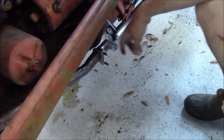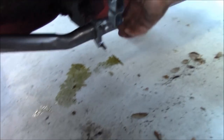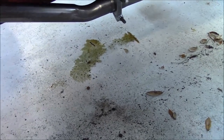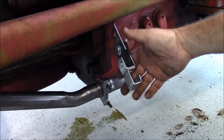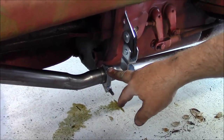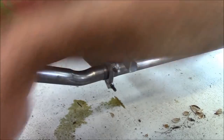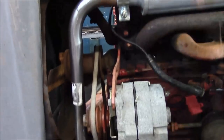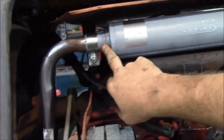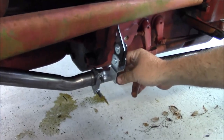Because these pipes are slightly different, notice that this exhaust hanger no longer works — this is obviously not a factory exhaust hanger. So what we're going to have to do is find another place along the way to support this, because that's a long moment coming all the way up to the engine. This will vibrate and cause a failure either here or here in the muffler. So we want to stop that vibration — if we support this pipe, then it doesn't have to carry the load.